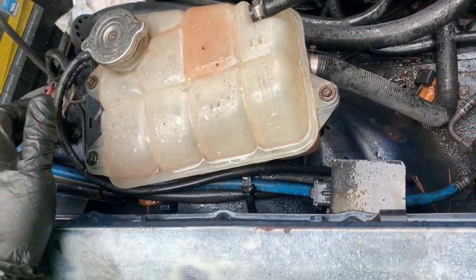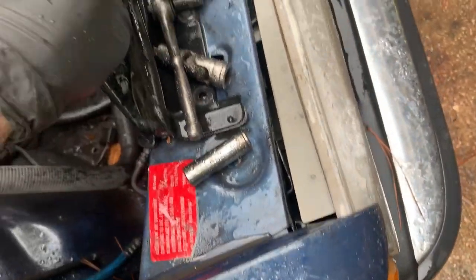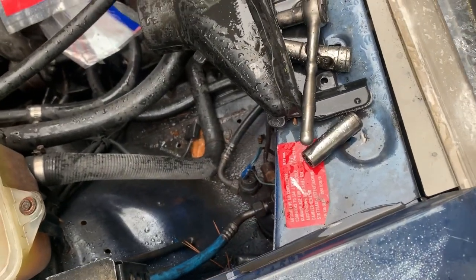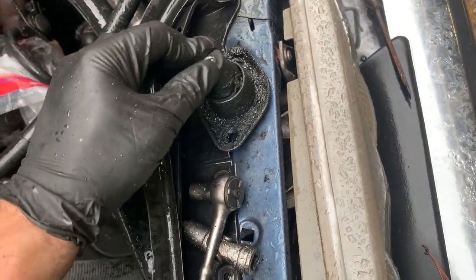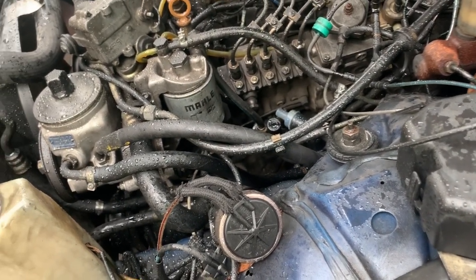It is slightly compressing the rubber, so I've got good spacing. Between the bracket and the shock, I was able to use 10 millimeter hardware throughout - one in the front, one in the back. This is the old rubber piece that was on it - you can see it was completely shot. My other one from the parts car is still in good shape, so we'll leave that one. It's been raining so I've been working in the little spots where it lets up.